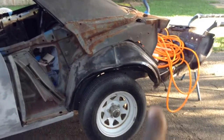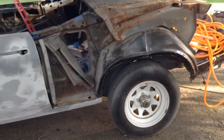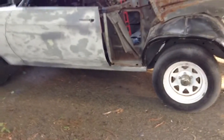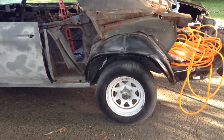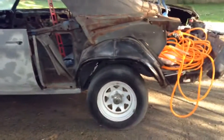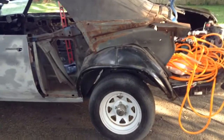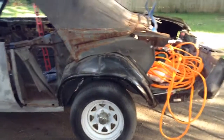I also did some measurements of the wheel houses that are in here now. I know they're jacked up, but I just wanted to get an idea of how much rim I can get up under there, because I'm probably going to order my outer and inner tubs — the hoops — for those 22-inch HRE rims. I want to go as big as I possibly can, and preferably I don't want to have to do any notching of the frame or widening the tubs.